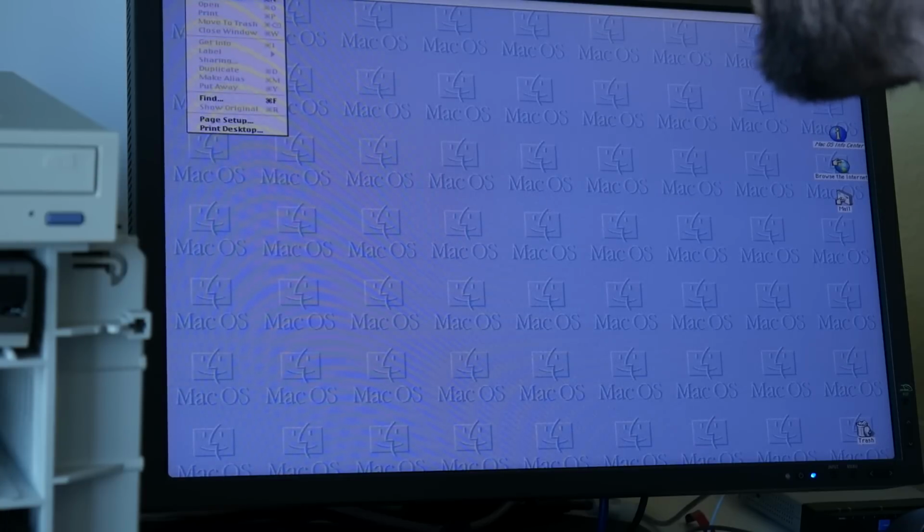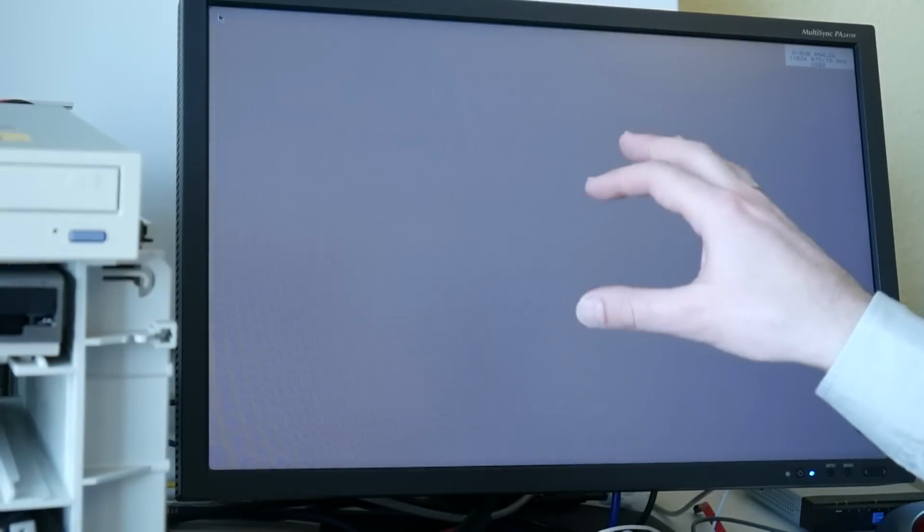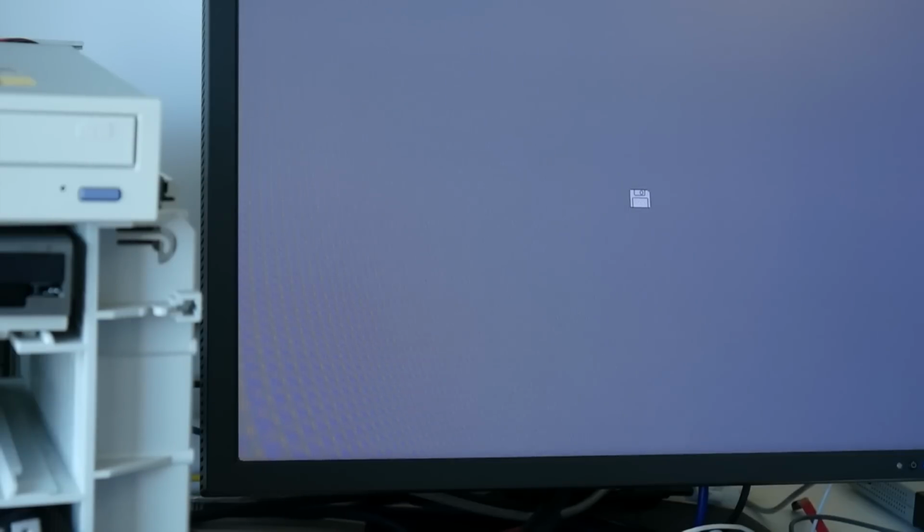We also want to go ahead and try booting this Linux. Also apparently, because this hard drive is not auto-starting for some reason, maybe there's a jumper for that, on a fresh power cycle the machine would not boot from this disk, because obviously, like Linux, the firmware here is not sending the start command. But anyway, this hard drive is too small, so this was only a first test. I already ordered an SCA adapter a minute ago. In the future I will use one of the bigger, newer 4 GB SCA drives with an adapter and put it in here also. As these plastic tray things here are extremely hard to find, I couldn't find any on eBay right now. And if I find them, they're probably as expensive as an SGI drive base, 50 or 100 euro, for a stupid plastic piece.